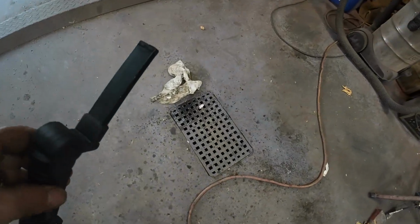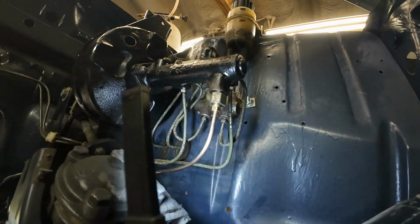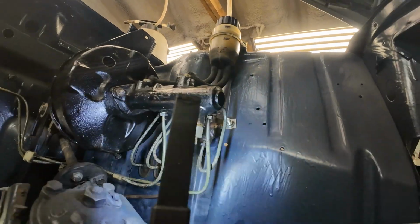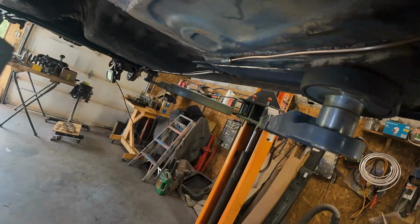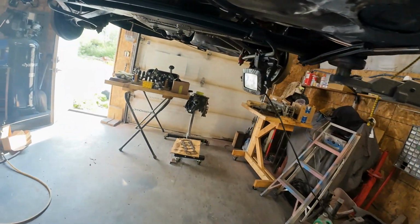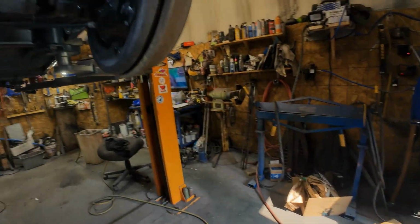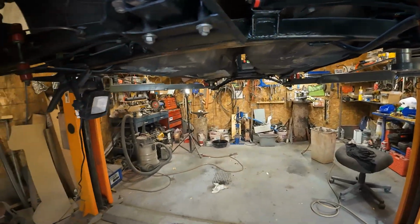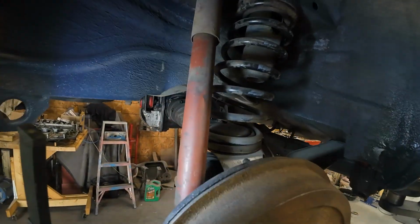There's the remnants of it right there. Anyhow, I'd forgotten, I didn't tighten that and that. They were not tight, so they were leaking. Now, none of the other joints seem to be leaking. Well, who knows yet, till we get fluid back here. But now I'll start bleeding. Bleeding, not me, the brakes. The brakes I'm gonna bleed. And they're supposed to start at the furthest away wheel, which is right here. So I'll get my gear and we'll do that.